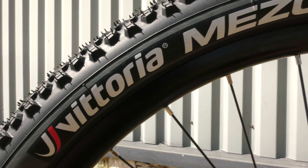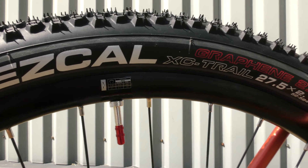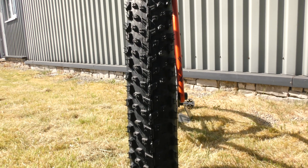Tyres — I know we had a long text conversation about tyres to get these nailed. In the end, these are the Vittoria Mezcals in 27.5 by 2.1 — this is as wide as that frame will take. These are lovely — graphene compound, so they'll last a long time, dead grippy, with a nice consistent centre tread so they roll really easily, but you've still got some bite on the corners. When you turn into that loose gravel over hard pack, you've still got grip. It's going to handle a bit like a mountain bike.